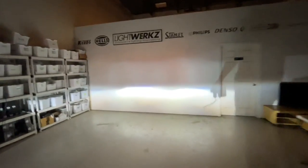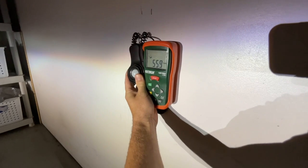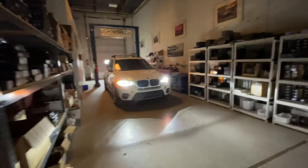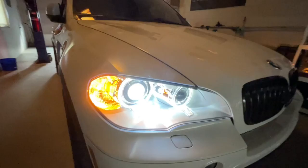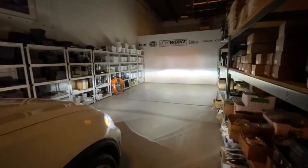These aren't known to be the world's greatest projectors and they have some strange cutoffs, but the important thing is there's actually light on the road. If you recall, before we started we were under 100 lux — about 93 — and now we're hitting about 550 lux, so over five times the intensity change just with clear lenses. We could boost the intensity further with a projector swap or different bulbs, but this was just the front plastic lenses. The results are twofold: you have a much newer-looking vehicle now that the lenses aren't fully clouded over, and you actually have some usable output on the road.